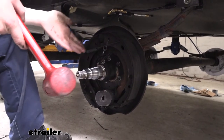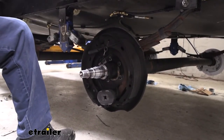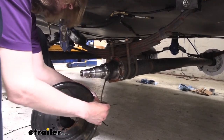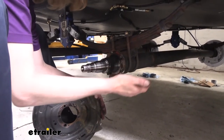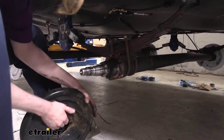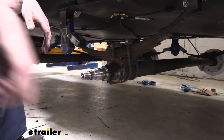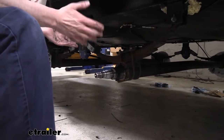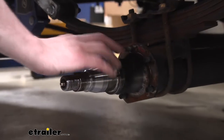Slide the assembly off. I always like to leave a little bit of excess wiring on here - put a cable tie and wrap it around the axle. That way, if they ever wanted to convert back to electric brakes, they still have the option to do so easily without running too many wires. Slide the brake assembly off to the side. I'm going to do a little more cleaning - get some of this brake dust off, and clean up where the grease seal is going to ride.